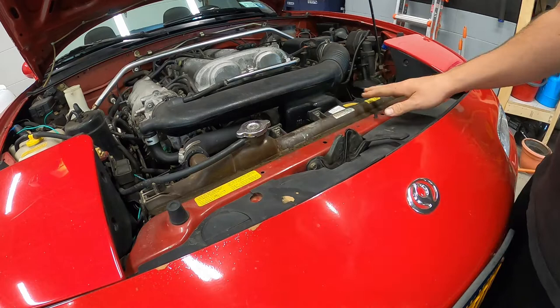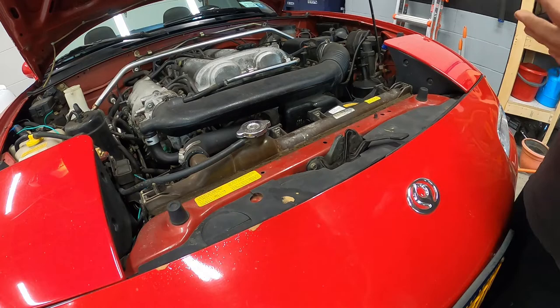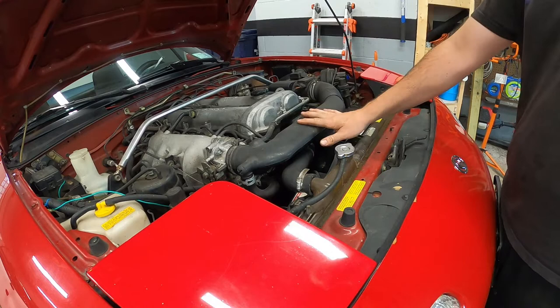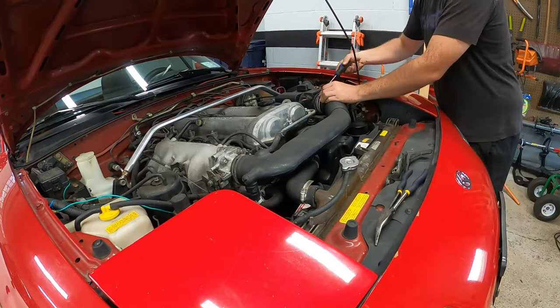You can see here what I'm talking about — it's really, really brown. This is an OEM radiator, still has all the Japanese warning signs on it. The car's got 130,000 miles and I'm really impressed it's made it this far. It's a 1995, so this radiator is 25 years old and it looks about ready to pop. First thing I'm gonna do is take off this crossover tube — this Helmholtz resonator is pretty big and might interfere with the fan motor. Just unhook it from here and here and pull this piece off.